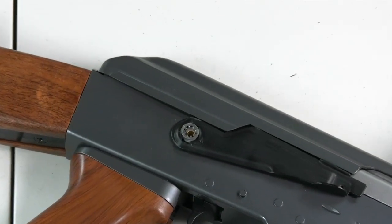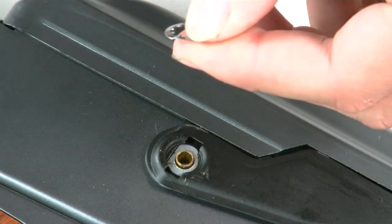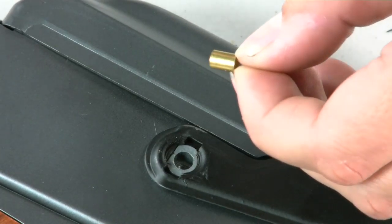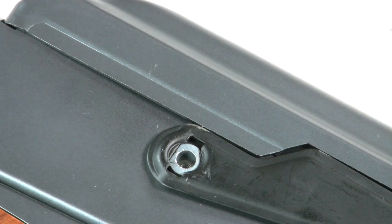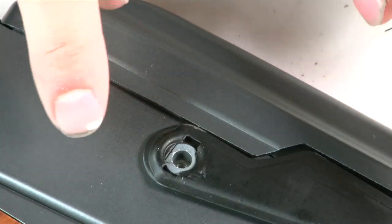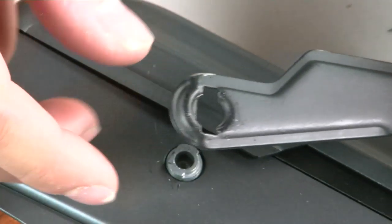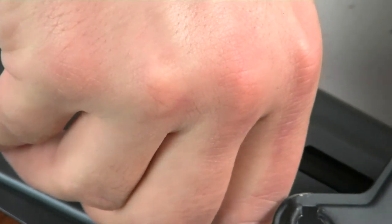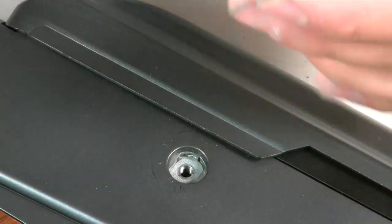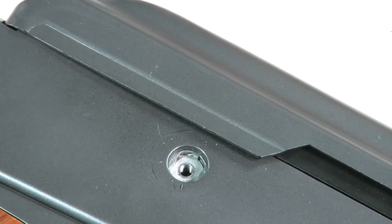Let's zoom in so you can get a good idea of what's going on. There's your lock washer, and there's your brass bushing. Once you've done this, there should just be the linkage hub and the selector arm. The selector arm should come off — most times it's pressed in there pretty hard, and it may take the linkage hub with it. Take the linkage hub out with your fingers, or if it doesn't give, use a screwdriver to lift it out. Keep all your hardware together — don't lose it.